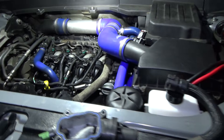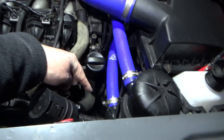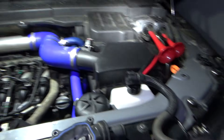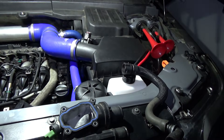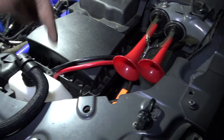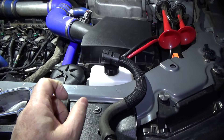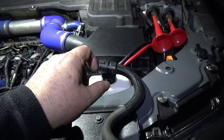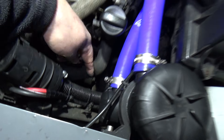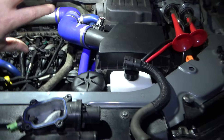There is one other oil cooler fitted to automatic gearbox vehicles. If you have an automatic gearbox, there will be another oil cooler for cooling the fluid in the automatic gearbox, which can also get very hot. The manual gearbox doesn't have one, but the automatic does. It takes water from the top of this end of the radiator — there's an extra pipe out of the radiator through the oil cooler — and then it joins back into the bottom radiator hose via a Y-piece branch that takes the water to the thermostat housing.